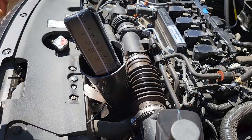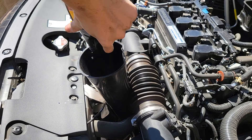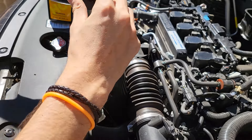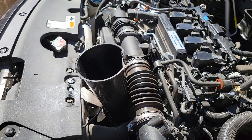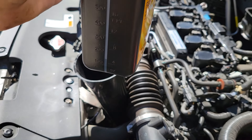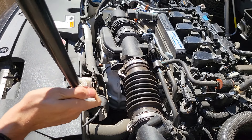I'm going to be using a total of 3.8 quarts today. It is recommended in the manual to use 3.7, however I've done this a few times on my other car as well and I'm seeing that it fills at around a 3.8 interval. You can use the check plug method, but for me 3.8 works well. A good way to measure 3.8 quarts is to have around 6 ounces left on your 4th bottle.